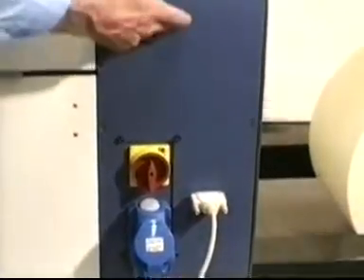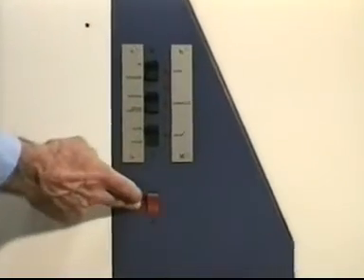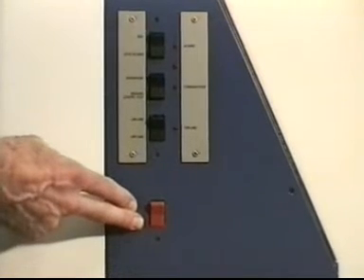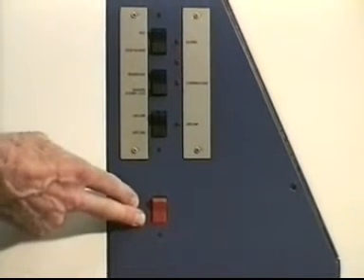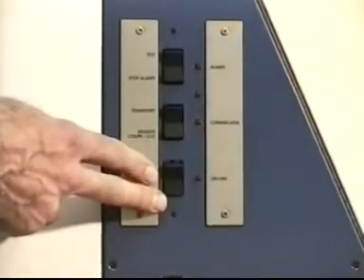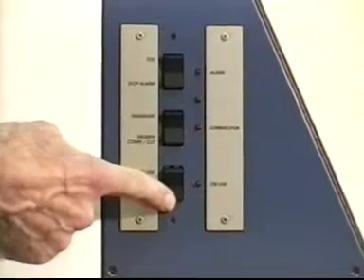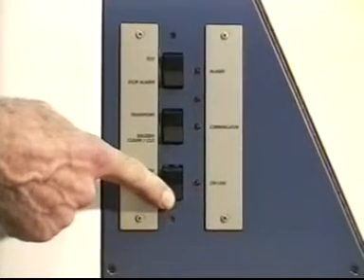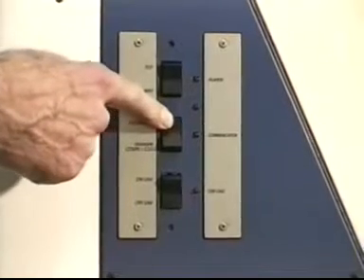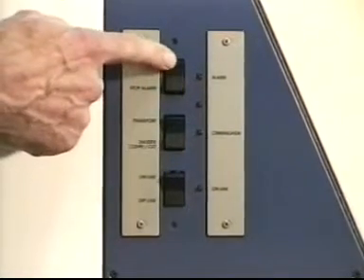In the upper part of the command panel, there are only 4 switches. The lower switch, the red one, allows us to turn on the machine manually. The next switch is the online-offline switch. Online, the machine is listening to the computer. Offline, it allows us to perform a few local commands such as move paper, cut paper, and make a self-test.